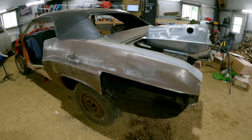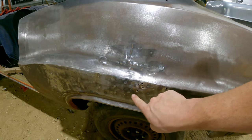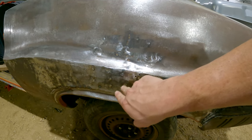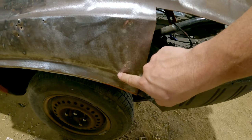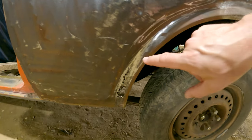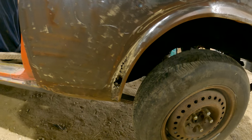We've run into a little bit of a snag. It's not really a big problem, it's just more delays. I've been working on trying to get this panel cleaned up, and while I pulled out a bunch of this area, I found more areas where the previous repair tried to go through with the puller, slide hammer, and drilled in and made a giant mess of things. There's some over here, some right down here on the style line, and worse — discovering more rust, like I've got over on the passenger side.